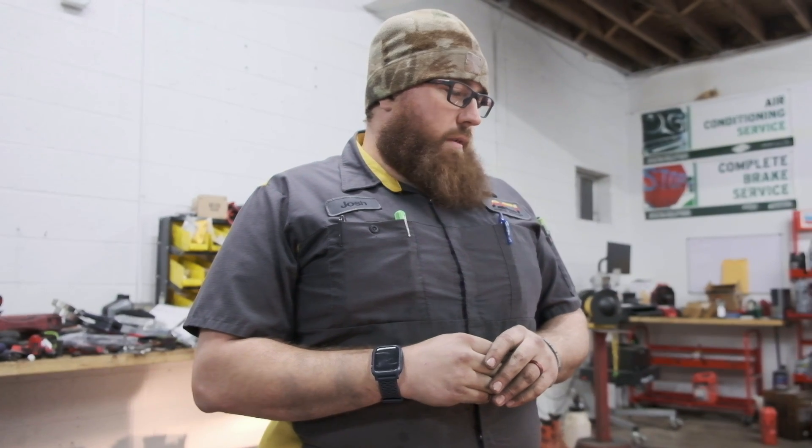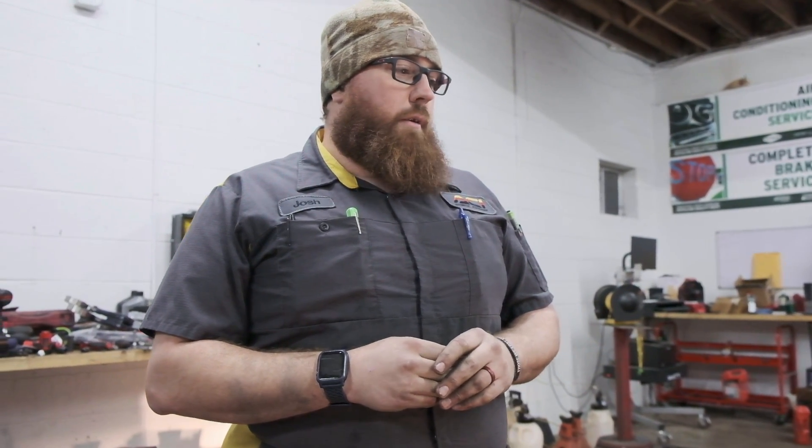He has smaller hands — little baby hands — and he can get there and do things that I can't do. He also has a lot better memory than I have now, about 10 less concussions. So he got in there, took care of it, and got it all figured out. Side note on this one: if you do upgrade to the aluminum water pumps, the bolts that are in there sometimes may be longer or shorter, so keep an eye on that. If they're not long enough, they won't get tight enough and it will cause a leak. The coolant temp sensor has two bolts that are different lengths than the other three bolts — it's five bolts total. Keep an eye on those two bolts. Volkswagen guys, if you're doing this job on your Volkswagen, the updated part number has two longer bolts in some of them. Keep an eye on that — it makes a difference.